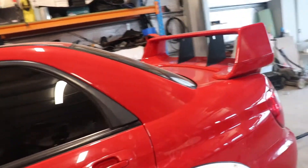Now in terms of height, the rear's got enough adjustability and it's set up perfectly. It's just the camber I want to fix. We're almost going to go no camber at all, but having a look at the rear, it's actually on the inside here. I'm going to change the side and then we'll go from there.